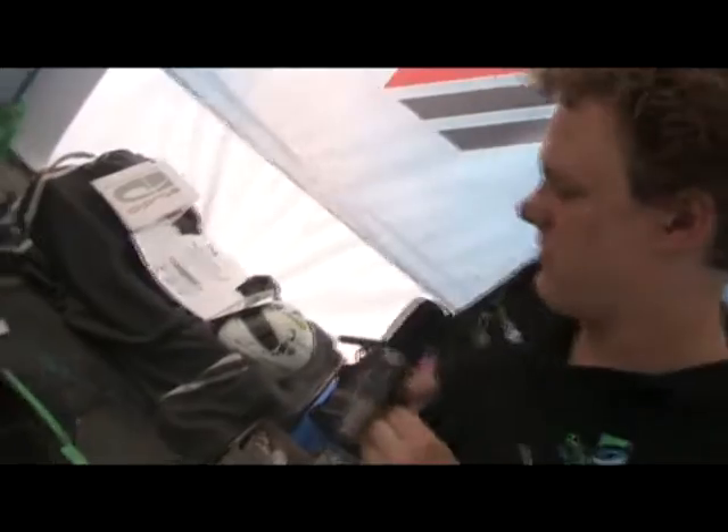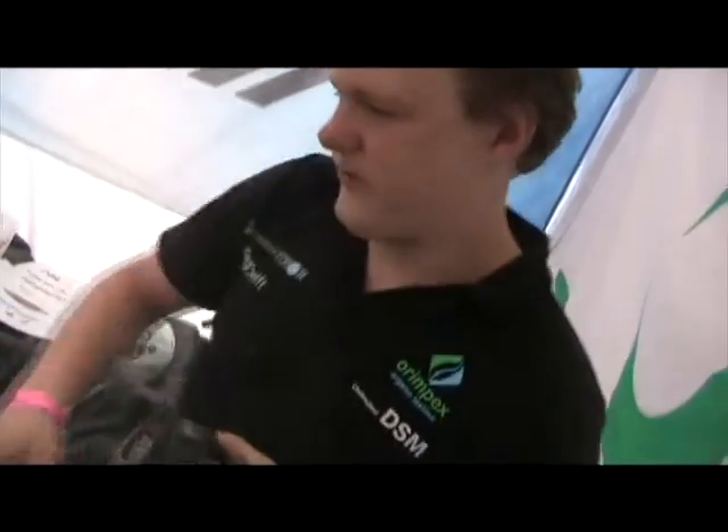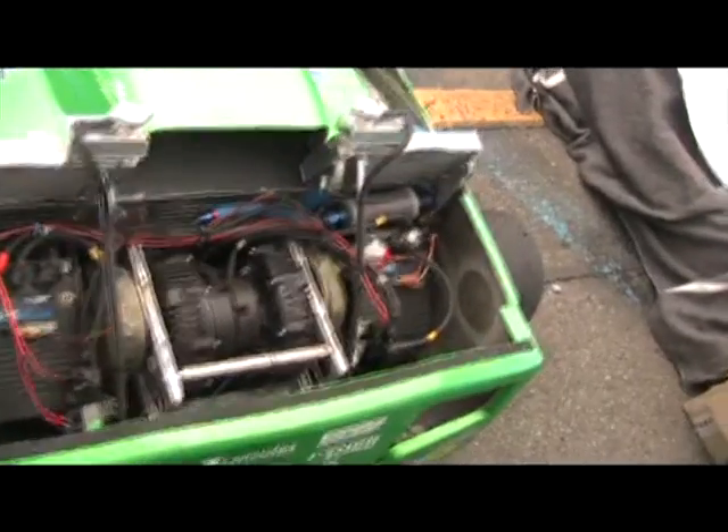The differential effect means we don't need the same speed on both wheels when taking a curve. When you take a curve, the weight ratio shifts from one wheel to the other, and one wheel cannot absorb as much power as the other. So we have two separate axles to make sure the wheel speeds don't have to be fixed — and we can also regulate that independently.